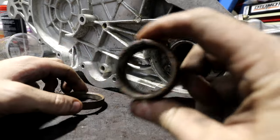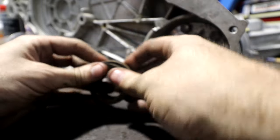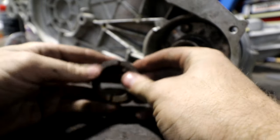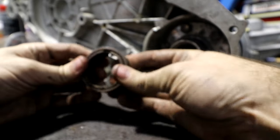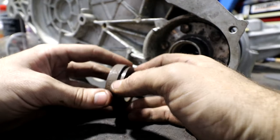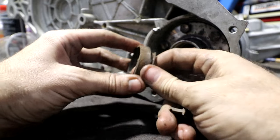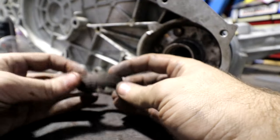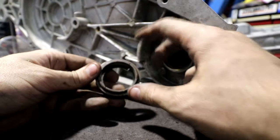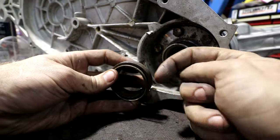so that's why this side doesn't need a specific bearing. What happens is these go on there, then this ring fits over the top of it to lock them together, so there's no way for them to split and come off. And once these are in there, they're a bit rusty, I better give them a bit more of a clean up. It's kind of nice seeing how rusty this stuff is, because the inside of this whole thing was this rusty, so it's cool seeing how far it's come. But if I can eventually get these to fit in here, okay, I've put them in there now, I can't get them out. Once this ring is over the top, these can't separate anymore, and then this snap ring goes over there to stop this ring from coming out.